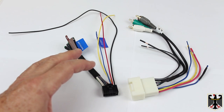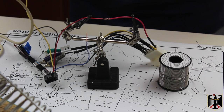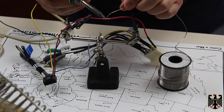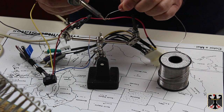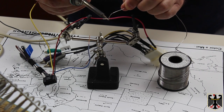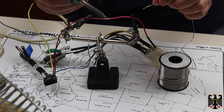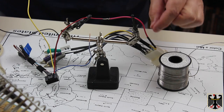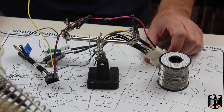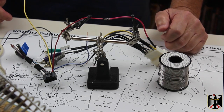I'm ready to start making my connections and soldering them. When you connect the wires together, you want to put them like this and twist them. Then you're going to heat from the bottom and put a little bit of solder on your iron — heat from underneath — and you want to use just enough solder to barely penetrate the connection. You should be able to see the wires in the connection but coated with solder. I also wanted to mention I put the heat shrink tubing onto the wire before I started soldering it, so the heat shrink is down here. I'll slide it up and heat shrink it. All the wires match with color codes — there are two blacks on the harness we got and one black on the other, so we're going to put the one to the two.